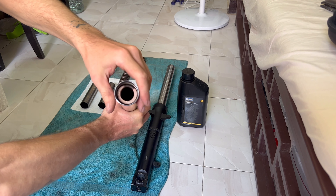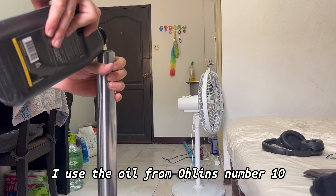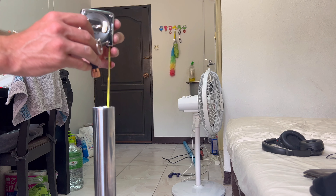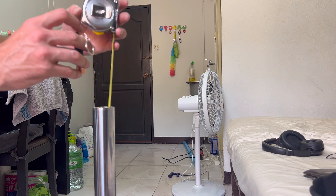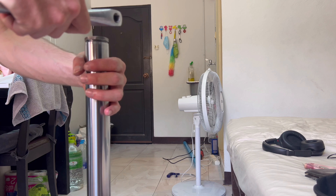It's not such easy work because you need to be clean and precise. It's possible but you need to focus well. We can go to the next step — putting in oil. We need to put a specific quantity: between 100 to 140 millimeters from the top of the oil to the top of the fork. If you have advice for me, let me know in the comments. It's ready — already closed and clean, ready to install. We'll go downstairs to install it on the motorbike and test the feeling.